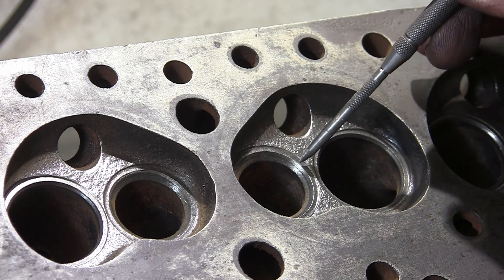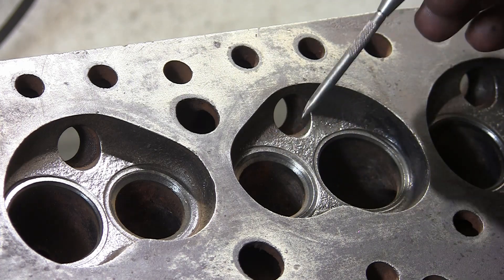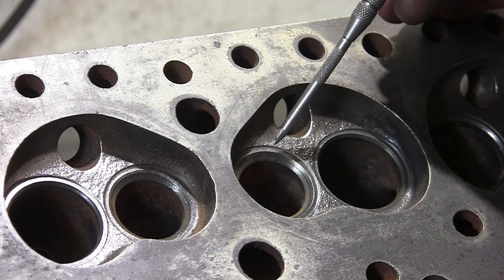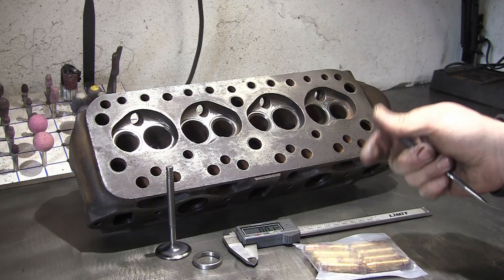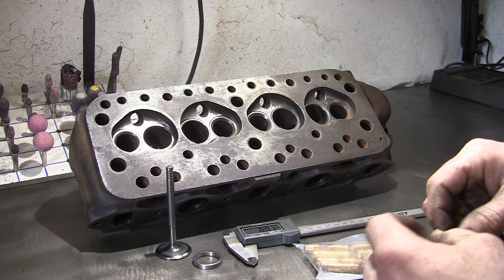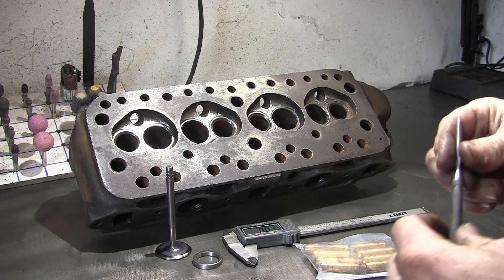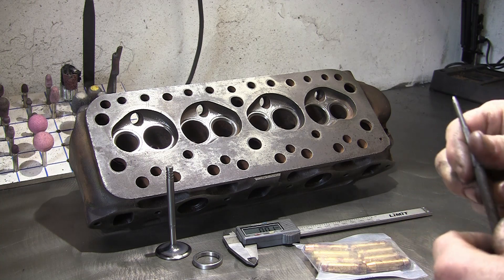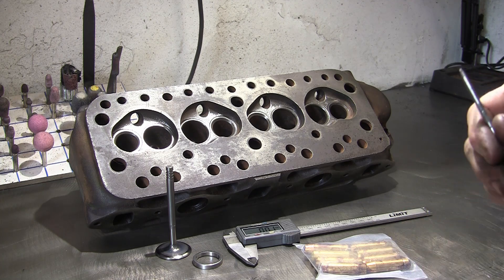For the exhaust, putting an insert in, so we could stick the stock size valve back in again. To compensate for the larger inlet, we'll actually go up slightly on the exhaust size as well, just to balance that out. So if you tune back in for part two, you'll see the work we've carried out, and then we'll do some flow bench testing, and we'll see what difference the larger valves and the multi-angle seats make. If you enjoyed this video, please have a look at our other ones, and please like and subscribe. Thank you very much.